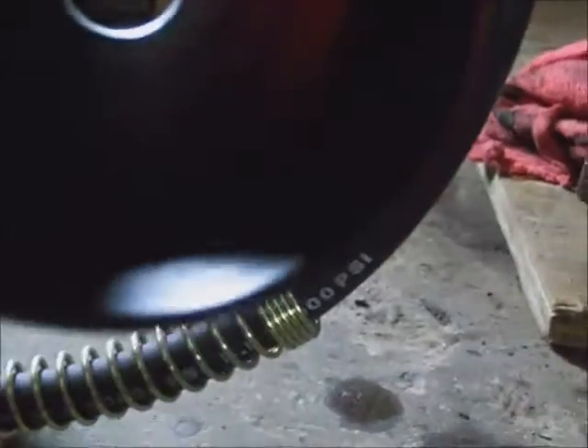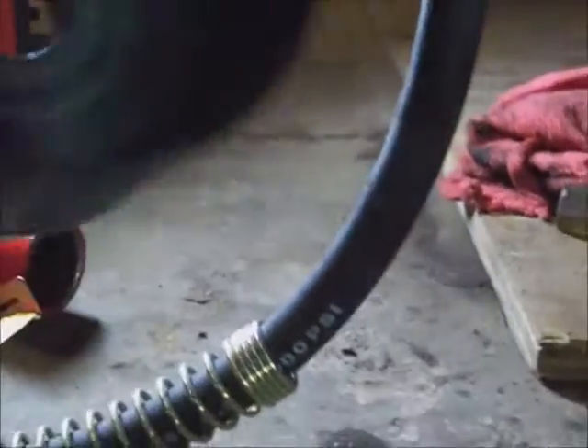It can sit on the axle tube. I've got my spacer set up on the axle tube and the nut to pull, and the spacer pulling on the back side. There's a little lip inside that holds the bearing from going through the back side, and you want to stay inside of it. I'll just tighten that down and it should pull the bearing through to the inside of this hollow piece of tube.